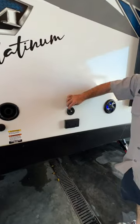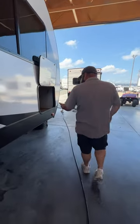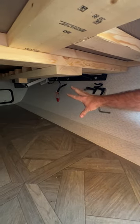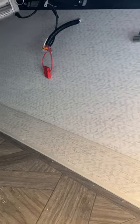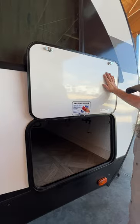You're able to bring a TV outside and hook it up here — you've got a 110 outlet for that. On the other side is the other half of your pass-through storage compartment. Right here are the straps that hold the manual cranks. This one is for your stabilizers. They leave this area open here so if the bed lift stops working, the first thing to check is that fuse right there to make sure it hasn't blown.